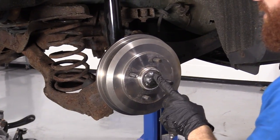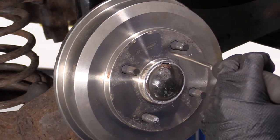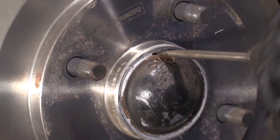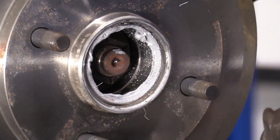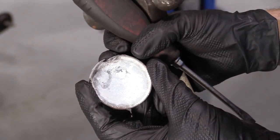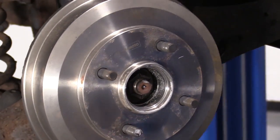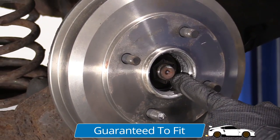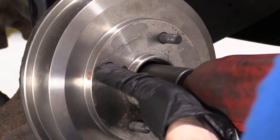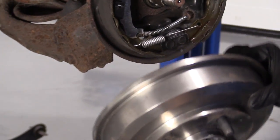To get your brake drum off, you're going to need to take this cover off. I just use a small flathead screwdriver, but a small punch is probably better. Just lightly tap right in between the cover and the drum itself and pop it off. It's a little bent over from where I brought the screwdriver in, so I'll peen that back and reseal it — this is just RTV sealant to keep moisture out. This nut right here is a 30 millimeter — just remove that with a ratchet or your air gun. A lot of times the drum won't want to come right off, but this one's pretty new and it came off very easily.